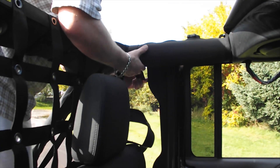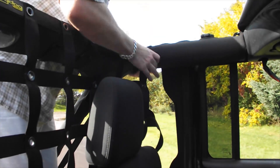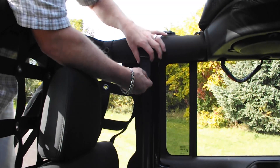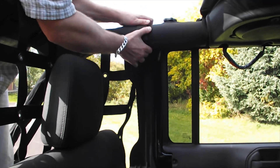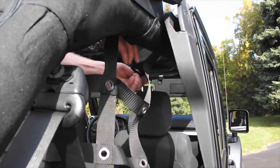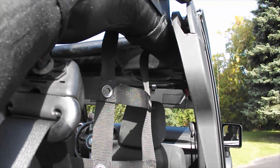Your final strap at this step goes on this side. I've got the track top so it's a little trickier to get the strap around, but it goes on no problem. You've got one strap left here on this side — this one wraps from the outside of the roll bar in a different orientation. It straps there and hangs positionally; sometimes you've got to slide it back a bit to get it in the right position. Go around and do it on the other side as well — wrap it around the outside of the roll bar, feed it through the loop, and that one's all installed.